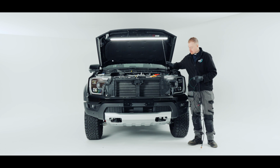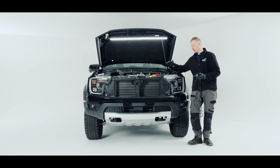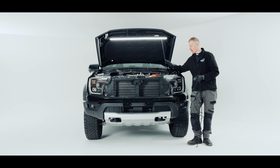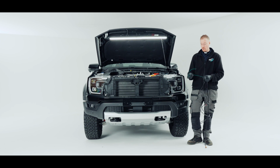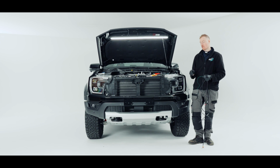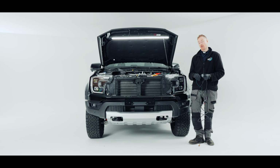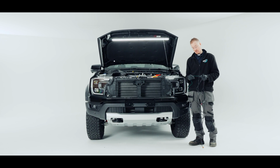As I said before, these headlights, we either put the full beam signal off the back of the headlights or to the auxiliary switches. So the green wire is the only one that needs to go through the firewall, as the position light wire is located in the passenger footwell, and not the full beam signal or the auxiliary switches.